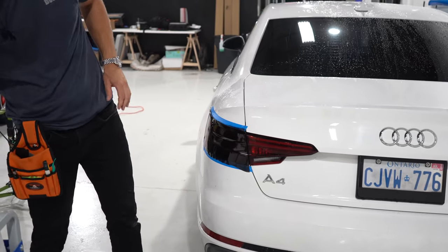For this bottom area I'm basically going to do a cut and it's going to drop. We've got to keep in mind that we don't want to cut into the light. So I'm going to cut on the very bottom side of this, take my time as we get closer to the edge, and then that's going to come down. Underneath the film or underneath the light it's not going to be tinted — but that's not a big deal. It's just black plastic, so we don't even need to tint that area. Squeegee the water out.